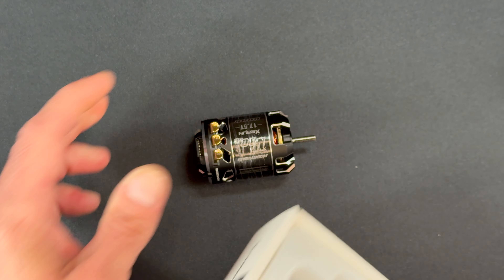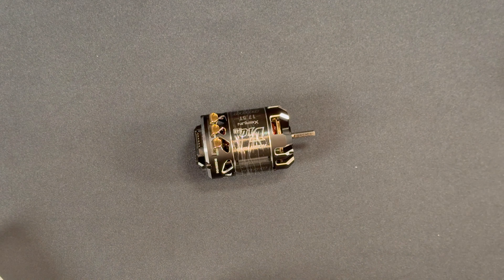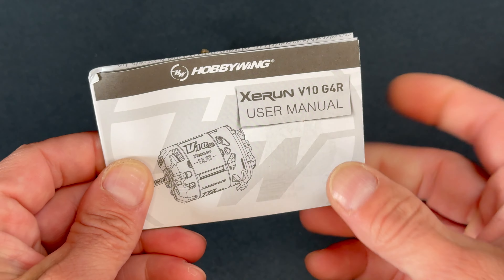The new sensor wires are flat, like everybody needs to run under the battery packs. You get your best friend in the whole wide world — the instruction manual. In the manual, you'll see the recommended FDR, final drive ratio. That's the spur gear divided by the pinion gear, multiplied by the transmission ratio of the vehicle. That gives you a final drive. These are very loose starting points for an out-of-the-box tune, just so you're kind of in the ballpark — a basic guideline. It may not be the fastest setup, but it should be the safest.